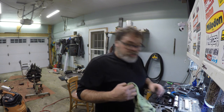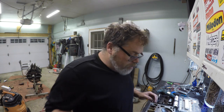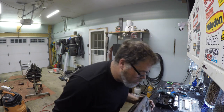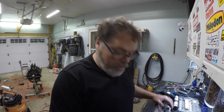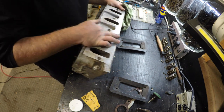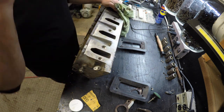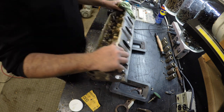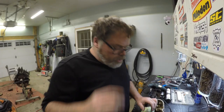Valves are lapped — I'm going to do a few more of them again. These aluminum heads are a change for me — I'm used to cast iron heads. I was going to port the intake runners but I think I'll leave them alone — I don't have enough material in the top half and I'm nervous I'll port through. So I'll just leave that alone. Valve seals — this engine didn't burn any oil.